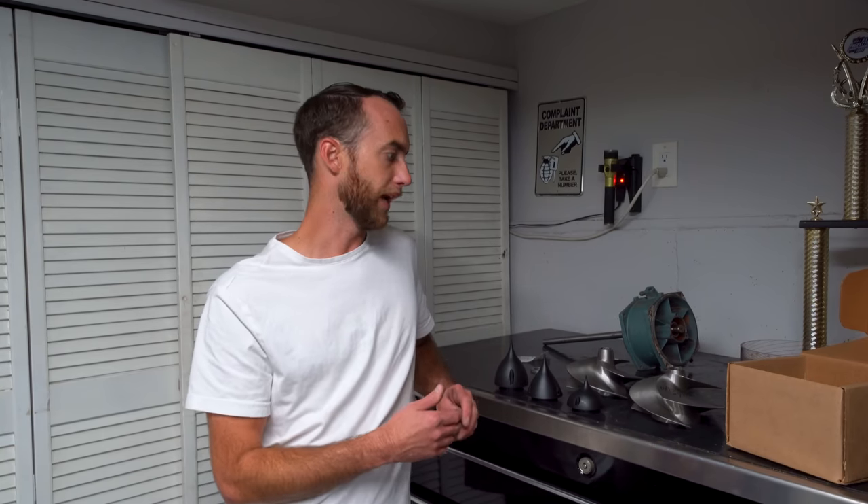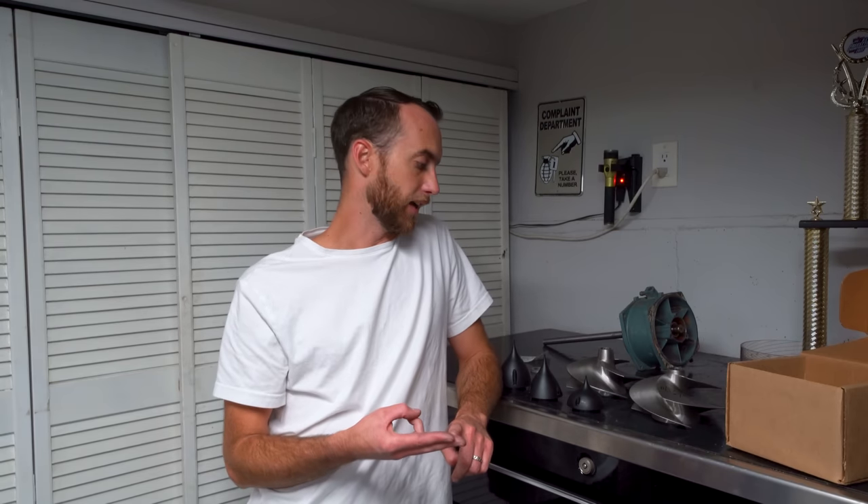So those are your main ways to tune a pump: pitch, spacing to the stator, nozzle size, and pump cones. You can use all of them together to fine-tune and figure out the absolute best setup for you. I hope this video was useful so you can get your setup dialed and take it to the next level. I'll see you next time — thanks for watching.